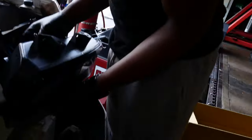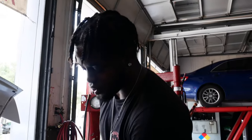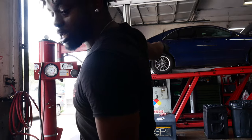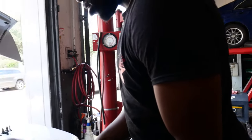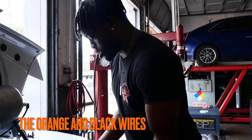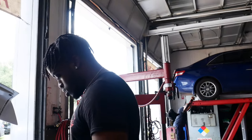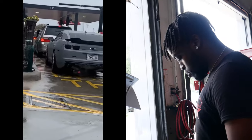Back to what you were doing, bro. We're hooking this up — finally got the harness and everything done. To get the sequential form, y'all are definitely going to want to unplug this harness right here — it's the two wires. Shout out to my boy Versatile. We were unplugging other wires trying to figure it out. Now it's sequential. Once it's unplugged it's sequential; when it's plugged in it's a steady straight signal. You did that to this one too? Yeah. Because it's going to go — when you hit the blinker the whole sequential will match.